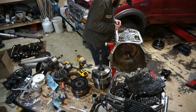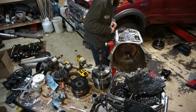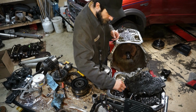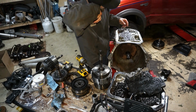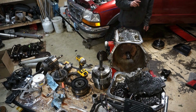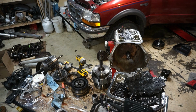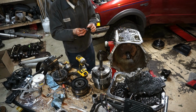Should be 7 check balls. And then there's this one spot that you don't put it in for the HD2 kit. So I don't think I'm going to use that one, because that one's from the bad one, and he said it didn't have second gear, and that's for the 1-2 low band. And I think I actually dropped the piece inside my bucket that I'm looking for. And I did drop it in my bucket. So I went in all the way. We went in deep, kids.